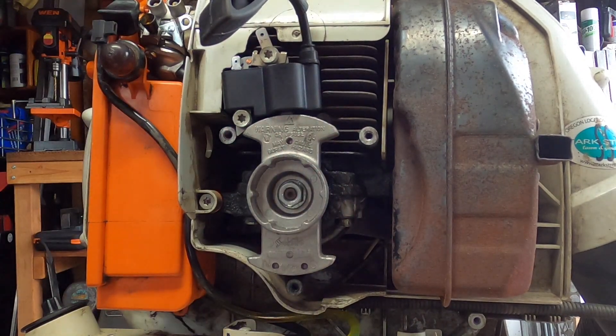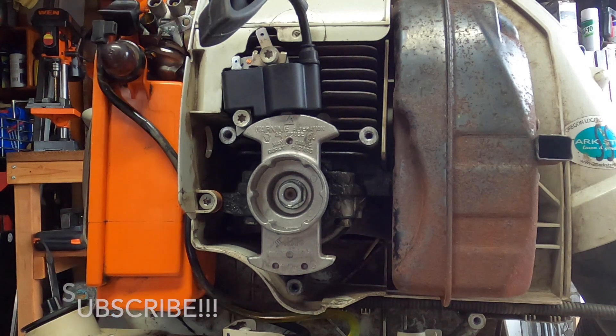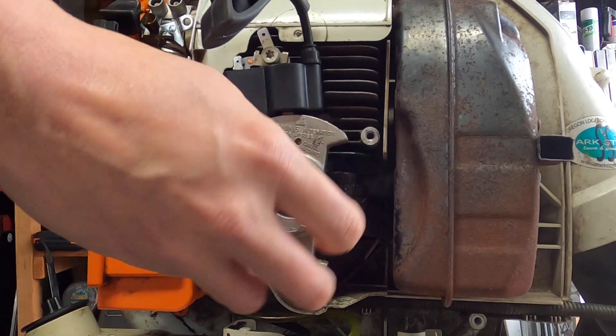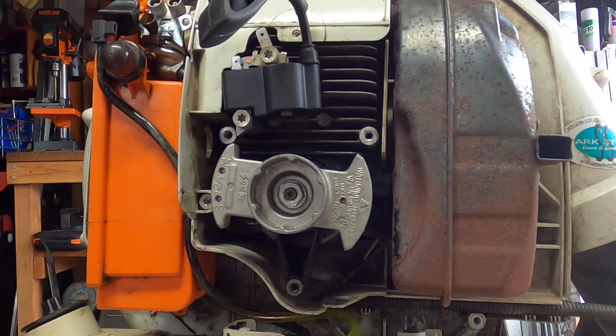The air gap is now between the coil and the magnet. The magnet should be the thickest part of the flywheel, so if it clears the magnet you're going to be fine. If you have rust, you'll want to clean it up — surface rust on the flywheel is generally fine, but caked-on rust will cause the gap to be too small and the coil to scrape. Rust won't ruin the magnetism as long as your magnet is working and you have a proper gap.